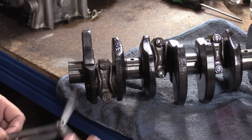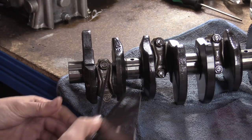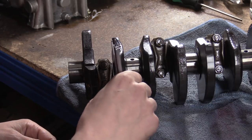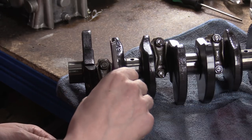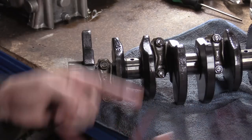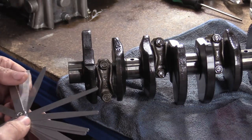Let's find out how big it is. Let's go 150 — 150 fits, oh hell, this isn't looking good. 200 — there's quite a lot of drag in there. 250 — no, it'll nip it but we're not getting in there. It's just nipping slightly as it turns in. Let's check the other ones. The limit was 100 microns.